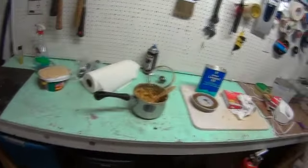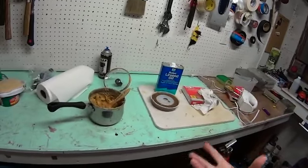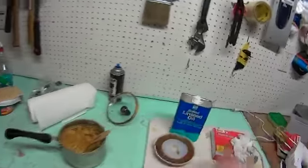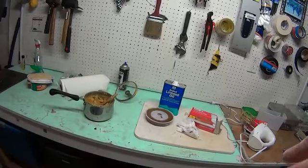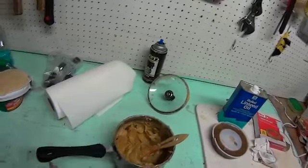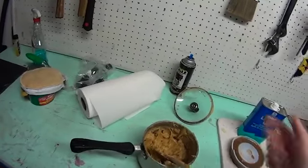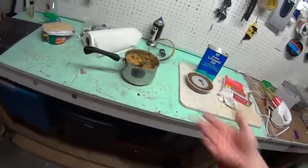Those products only work in perfect conditions — light rust, no grease, no flaky metal. If the frame is near the engine with oils and grease splashing on it, that grease penetrates deep into the rust and you'll never clean it off, no matter what chemicals you use. Products like POR-15, Eastwood, and Loctite will never stick to that. But with this wax, it doesn't matter if the frame is dirty, rusty, or has salt on it — just brush off the mud and big flaky rust and apply. When the frame is greasy, this wax actually sticks even more because it bonds with grease and oils.